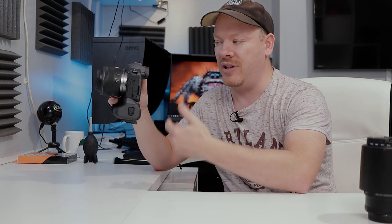First of all, I want to show you how you can see if your sensor is dirty. First thing you can do is go into photo mode, take a picture of a wall, a piece of paper, but just make sure that it is blurred. So you want to set your focus to a minimum, take a picture and you'll see the dust spots.